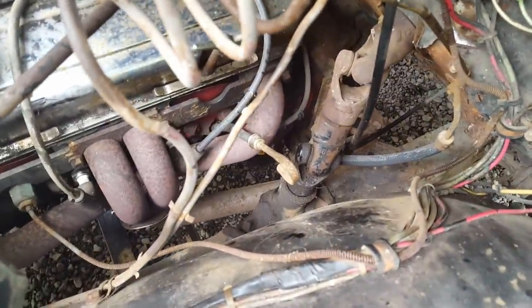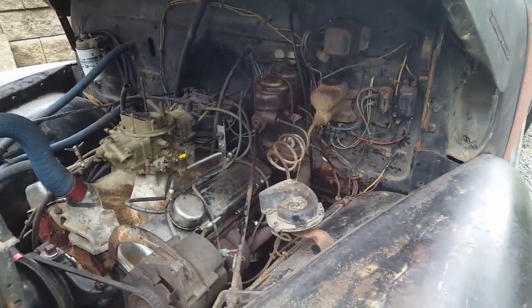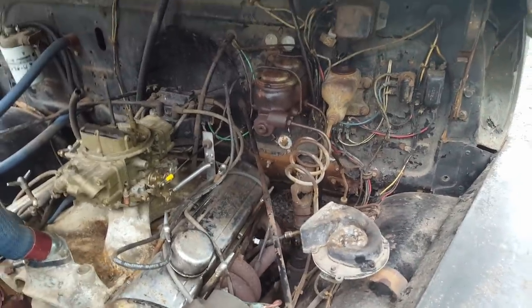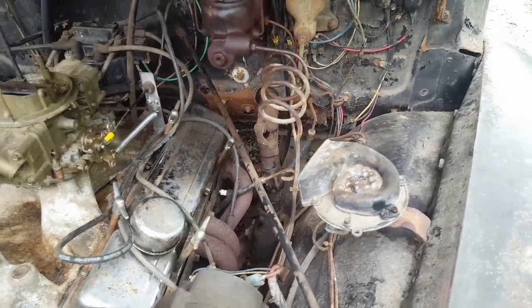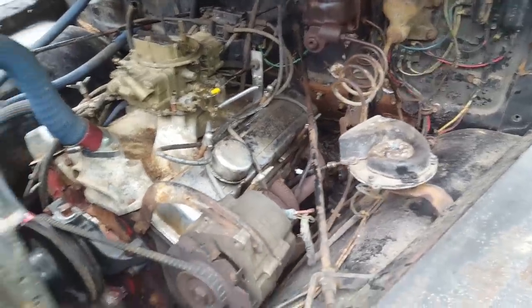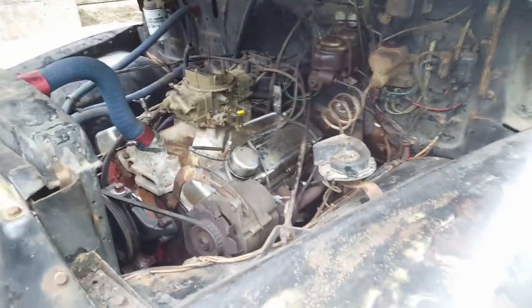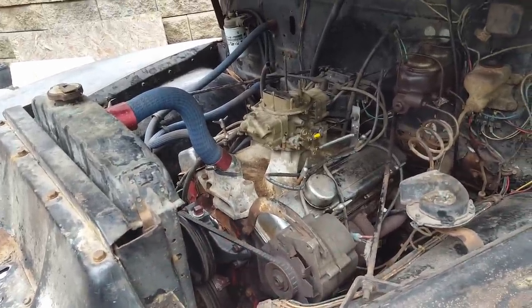Next, steering. It's got to go. It will wear you out trying to drive this truck. You got to stay on top of it because it's got so much slop in it. Plus, I want power steering because in a parking lot or driveway, unless you're rolling, you can't steer it. It'll work you to death. I'm thinking about electric power steering, which'll go under the dash. Then I might use the S10 steering box. I don't know, I'll have to look and see. Might go with a rack and pinion. I could go with a power rack and pinion, and I probably got enough room for a power steering pump in there, but I'd most likely go with an electric power steering pump just to make things easier. We've already went over motor options. I got plenty of options there.